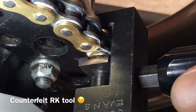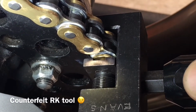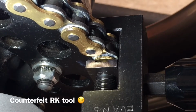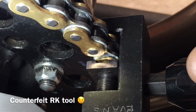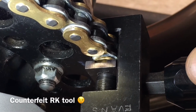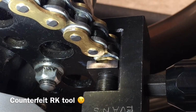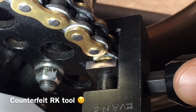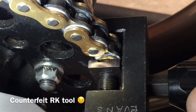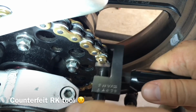Now, you don't want to overtighten, because if you press that plate too far over those studs, you can distort the entire length that you're working on and cause some issues. You just want to nicely start, if you can see in there, to compress the O-rings, and you'll feel some resistance. I just felt it there, and I back off just a hair, and I'm just going to loosen it off now, actually, and take it right off.